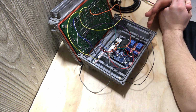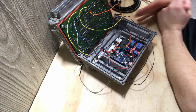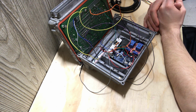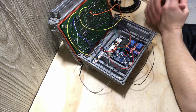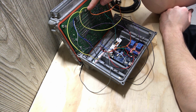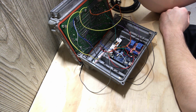So what it could do is use that GM Class 2 signal and read the RPM signal, and if it's programmed to anything above 2000 RPM, start cutting ignition. It sees 2000 RPM through that Class 2 line, and what it'll do is, up here, these are the low reference to the ignition coil signals. So the ignition coils on these, the signals going out, the 5 volt signals to the coils, because they're like a smart coil.